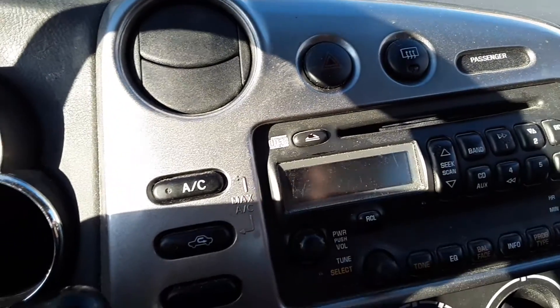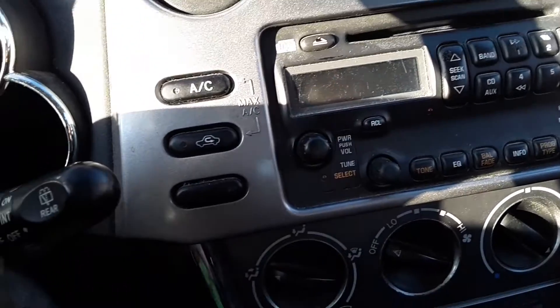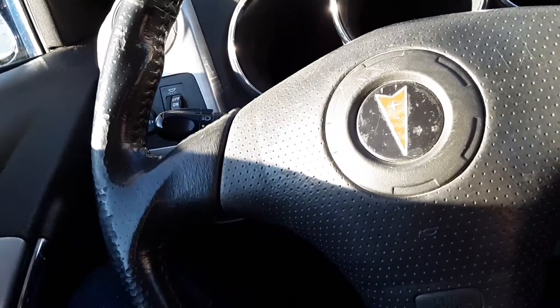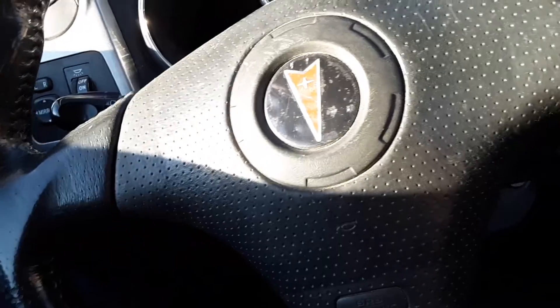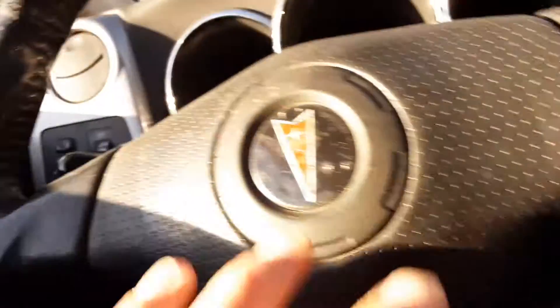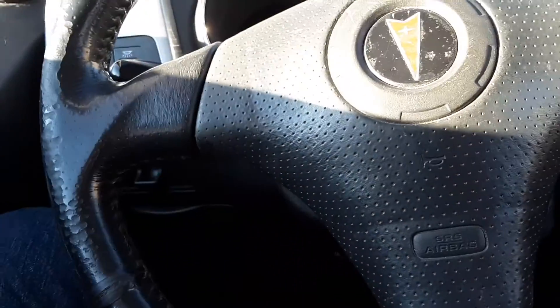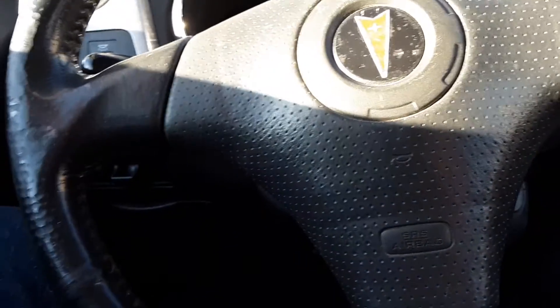This part here doesn't show anything. Let's go over what I've done already. I did the clock spring, which is pretty easy. Basically you go in and pull these two screws on the side here, there's one there and one on the other side, then these two screws here and one down here. You pull this piece off, there's a bolt holding the steering wheel on, then that piece comes off and you get your clock spring — it comes off with a couple clips on the Vibe.